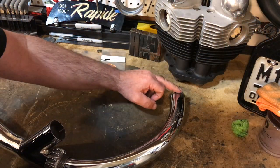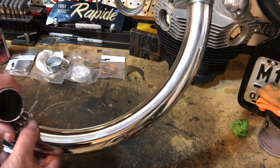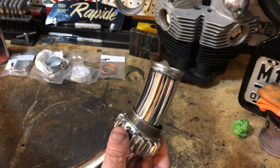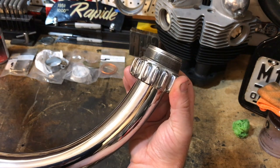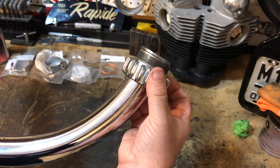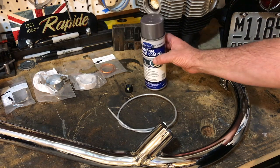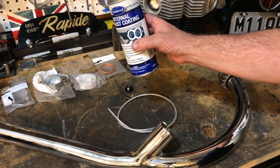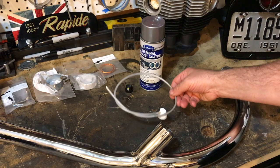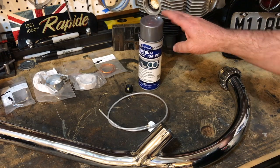There's minimal damage to the end here where the flange was welded on. That's just all that sticky residue cleaned off with some acetone, and as you can see those burn marks will be covered quite adequately by the nut. So, ready to start installing. Before I install the pipes on the bike, I'm going to try and coat them on the inside just at the header section here with this internal exhaust coating that I use for car exhausts and manifolds. It comes with this 360-degree nozzle, and my friend Dick has tried this on his exhausts.